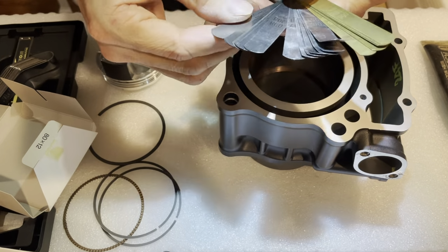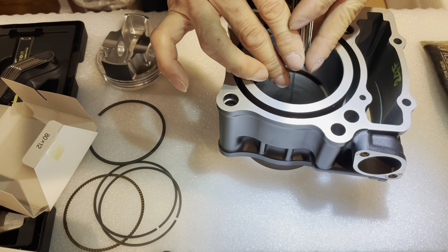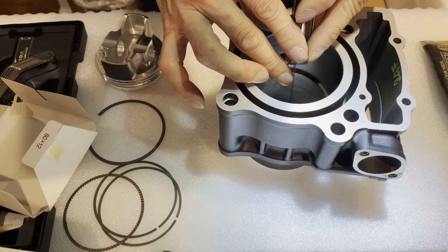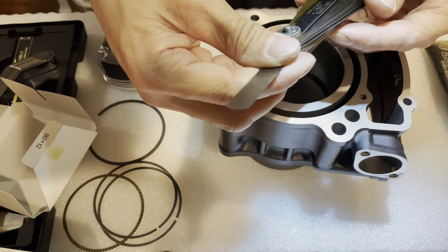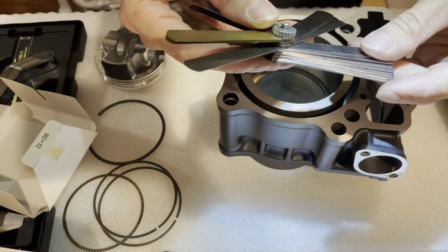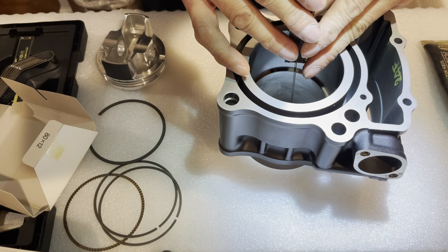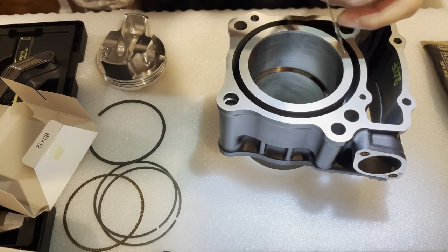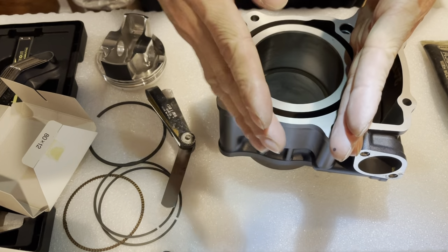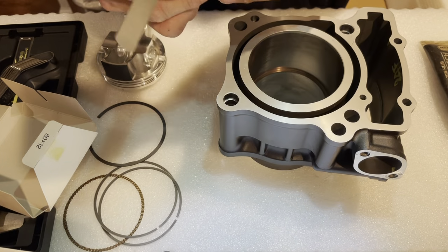Let's see how big the inside is. See if a 16 would fit, 16 or even a 17. Oh wait, 16. Yeah, that's about it. 16 will barely just go in, just barely. So it does have somewhat of an angle. So this is a 17. Nope, 17 doesn't fit. Okay, so it is somewhat like this. The very edge of the opening is 16, and the very end here is 12. So that's a difference of, excuse me, 4,000ths of an inch.